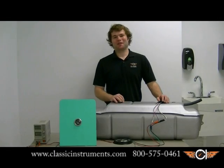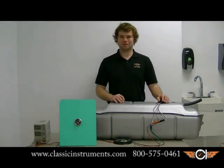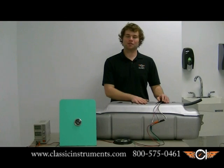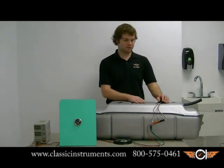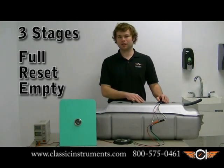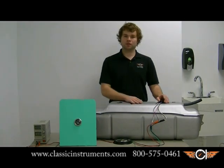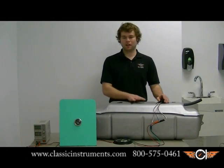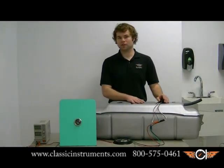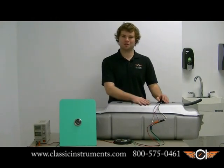If you're still having trouble calibrating your floatless fuel sender after watching the first part of our installation video, this part of the video is going to show you how to recalibrate it should you have any trouble or difficulty. The thing we have to remember is there are three different stages to the calibration cycle of this floatless fuel sender. The floatless fuel sender already has the empty position set, and all you need to calibrate is the full position of the tank, which we did in the first part of this video.